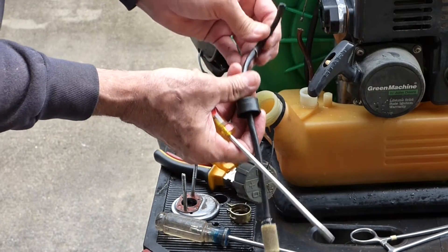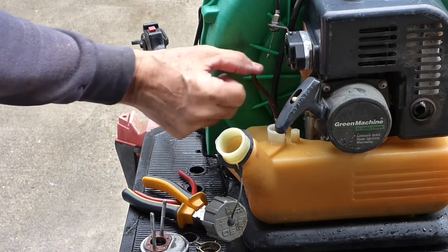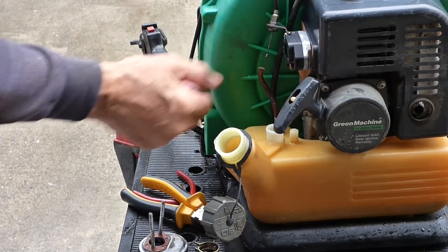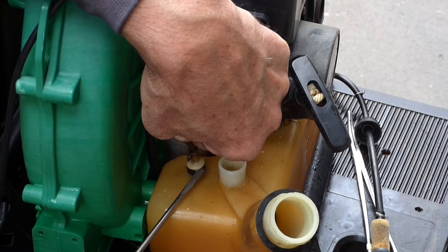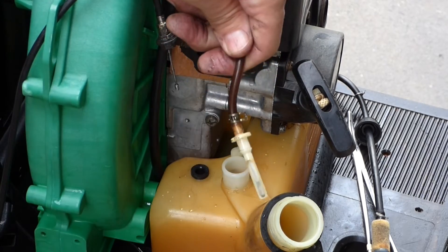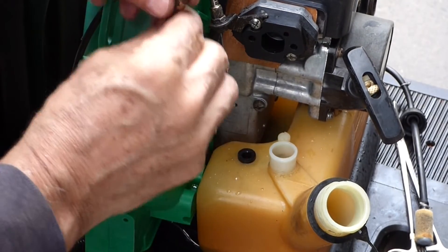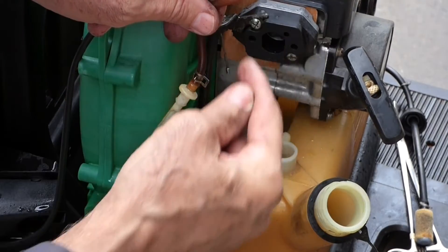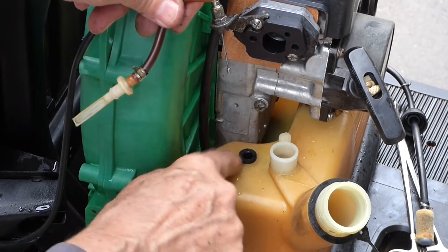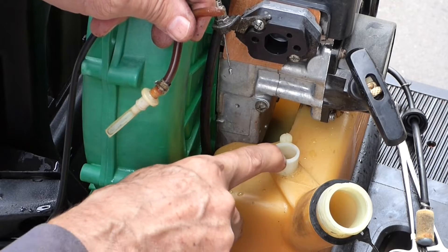We'll take this over to the workbench. The fuel line down here is actually good, and up here it's just a little stiff. But this one back here doesn't even bend — that's no good at all. You can put a little filter on that. This is just the little return line — when you push the prime bulb it circulates the fuel through and dumps it back in the tank. And this side was obviously the filter, which is the supply line to the carburetor.